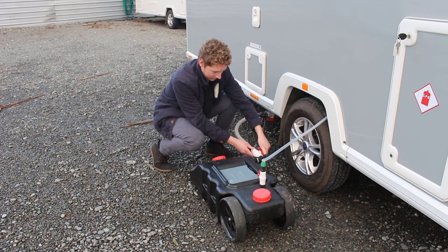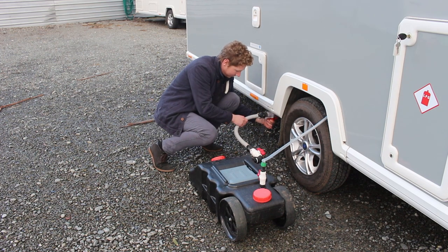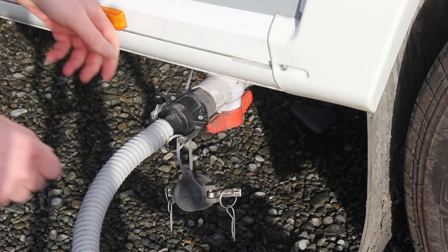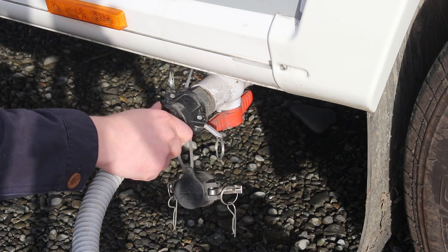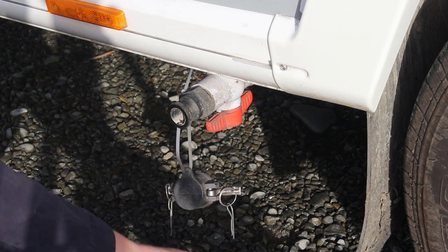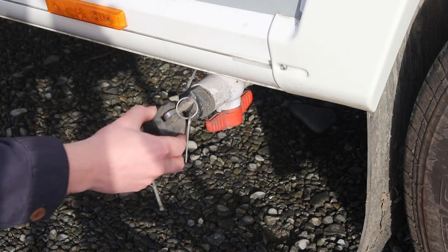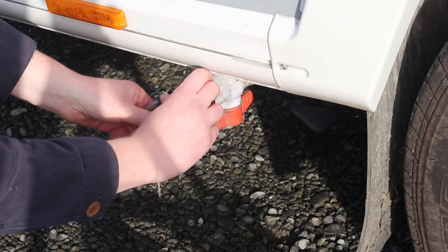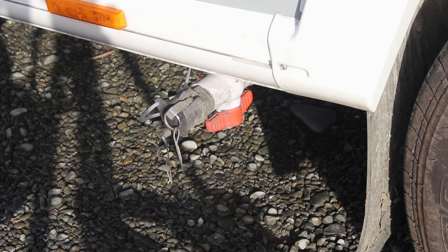The second pipe allows the grey water to flow from the caravan into the barrel. Again, it's important to remember that the tap at the base is open, running the same direction as the pipe. The pipe can be disconnected from the caravan by lifting the two metal wings and pulling the pipe off. There is a cap which can be applied in a similar way for travel to stop grey water spilling onto the road. If you suspect a drain is clearing slower than normal, you can fix this by tipping some hot water down the pipe.